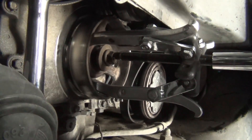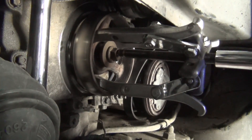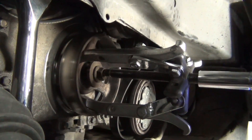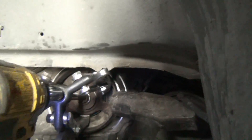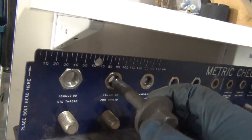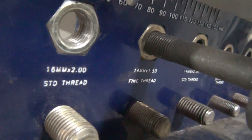Here's what it looks like pulling with the three-jaw puller. It's not budging a whole lot - it just goes pop once every now and then. I've got the pressure on it. Rather than having the puller just get a ton of pressure, you can actually tap on these things and sometimes that'll make them pop. I went through my bolts and found one that's really long reach - I think it's M14 by 1.5, and sure enough that's what it is.